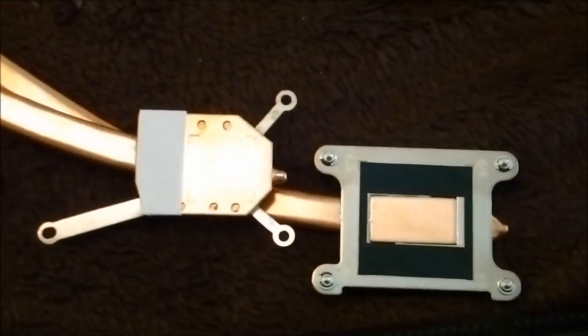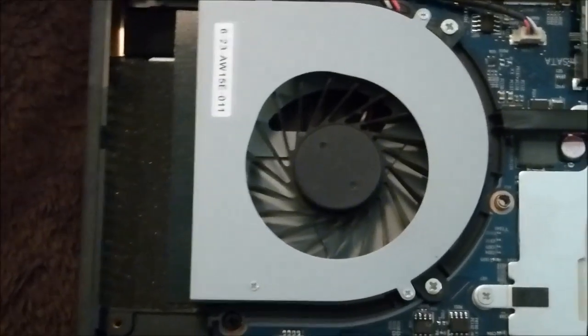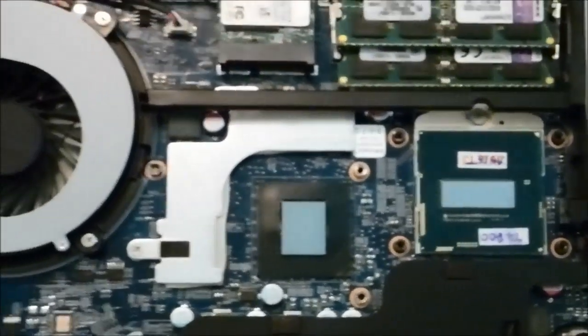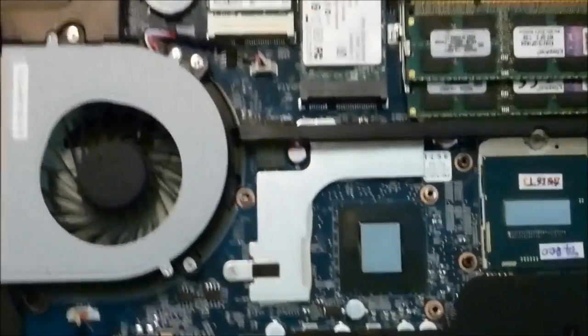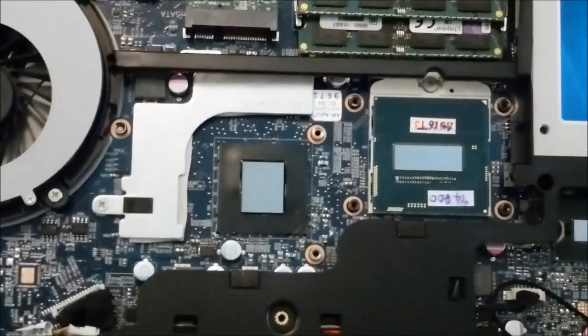Here's the heat sink — it's similar to the W110ER where you've got seven screws that come off easily. Two heat pipes to a heat sink which nestles right at that fan there. So I'm going to button it up now, reapply some paste, and then get it powered on and get Windows installed. I think I'm going to start with Windows 7 because there are drivers for everything, though I'm tempted to try Windows 8 since those drivers seem to be a priority at the moment.